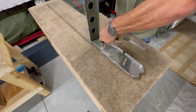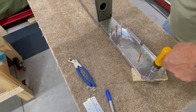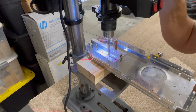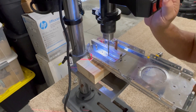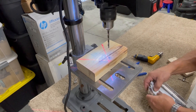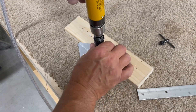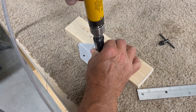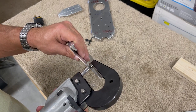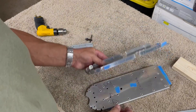This bulkhead is clicoed to the rear spar and then several holes are drilled. Among these are some bolt holes which go through the tie down bracket and will eventually house bolts which will connect the vertical stabilizer to the tail of the airplane. Next I countersink some of the other holes in the tie down bracket where it will be riveted to the bulkhead, and also dimple holes in the bulkhead to match those, along with a lot of other holes which are used to rivet the two halves of the bulkhead together.